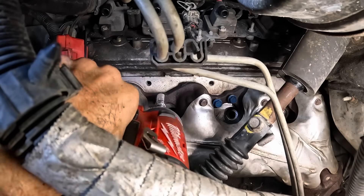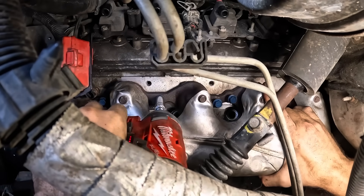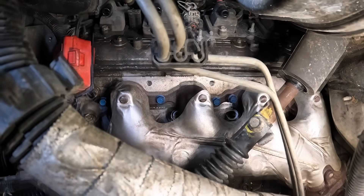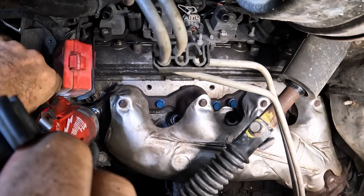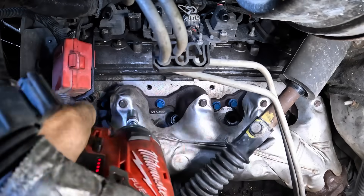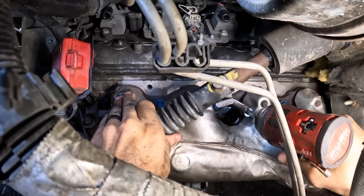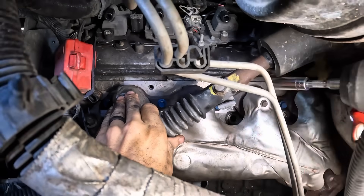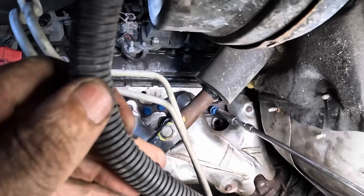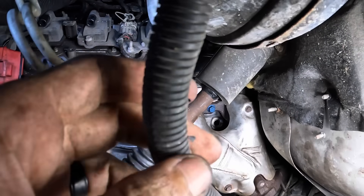Let's go ahead and run these guys in. Let's get them tight. We're at 11 foot-pounds — this is a dual pass torque spec. I'll leave the one in the back for all the way last because I've got to get that from the bottom. I reached down in there and got that back bolt on. While we're still up here, let me get this battery junction block bracket bolted back to the alternator bracket. Two of those bolts going into that bracket right there. Let me plug in this coolant temp sensor because it's staring right at me.